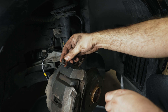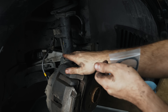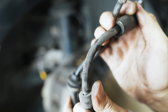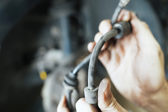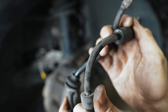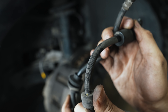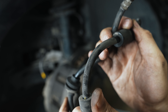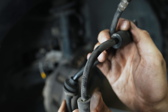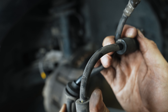They give you zip ties and bleeder caps, but with the way this is managed there's no way it would chafe or make contact with anything — it's installed just like the factory with two major mounting points, so I'm just going to use those. Keep the original dust cover because it snaps onto the caliper and stays in place. Now we'll move on and do the driver's side front. This one is right by the turbos and the line is visibly cracked — whenever you see cracked lines you have to replace them. That's one of the benefits of rubber: you can actually see when they age.